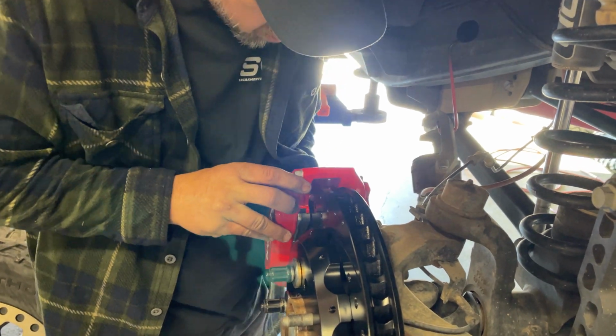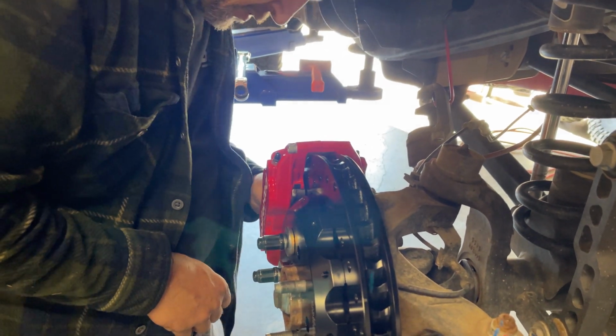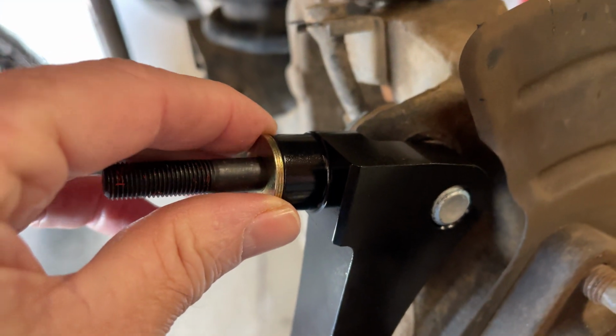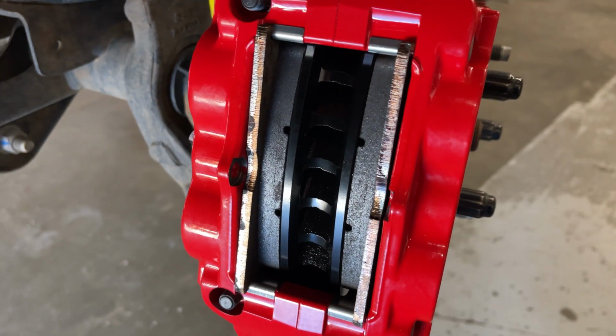We then added the brake pads into the caliper housing and noted that they were slightly low, as they should be at the same height as the outer edge of the rotor. So we added a 3rd shim washer to each bracket stud to confirm the brake pads were at the correct height. Once this is done, the caliper locking nuts are torqued to 30 foot-pounds.